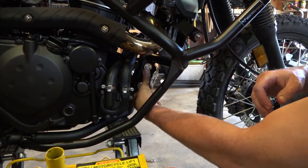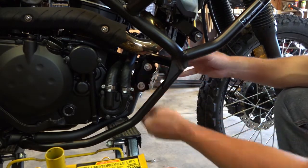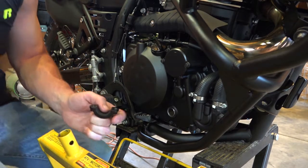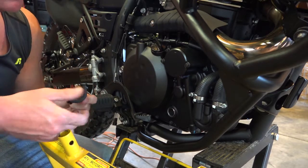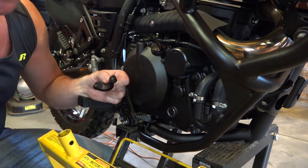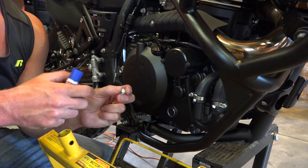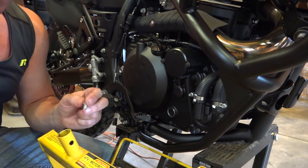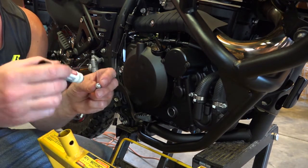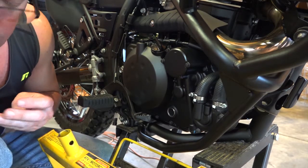There they are. I'm not putting a nut on the other side yet because we still have to do the other side of the crash bar. The only thing left to install on this side is the U-cap that goes on the back side of the lower frame mount — we've already got the rubber installed. This one goes on with the two short allen cap bolts that come with the kit. Apply a medium-strength thread locker to the threads on both bolts.